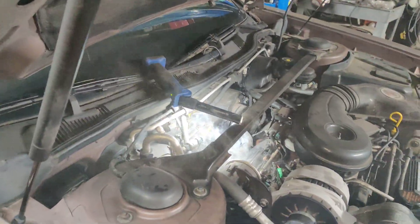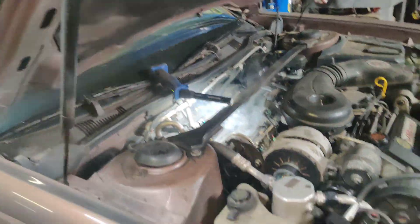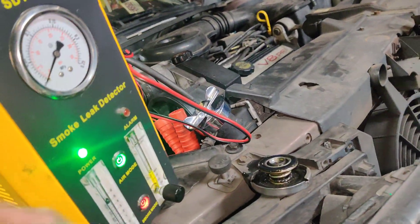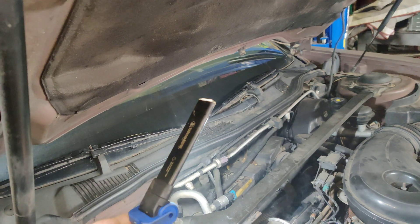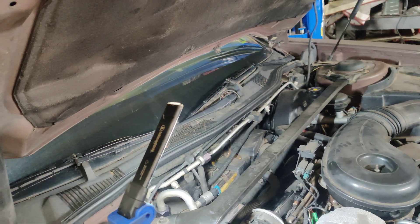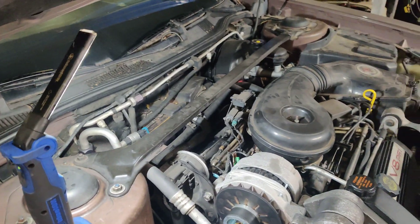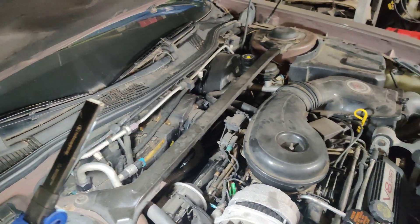See that? This is why this test is awesome. I never see anybody doing it, even if there's coolant in there — it'll push the coolant out wherever it's leaking. This thing will build like 20 psi or so. And it's a good way to test the system before you even fill the coolant. You can pull a vacuum on it, you can pressure test it with air, but you can see smoke come out. So let me go see if I have a tee.